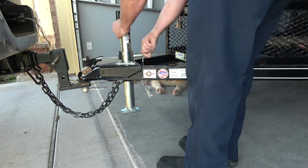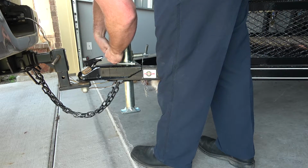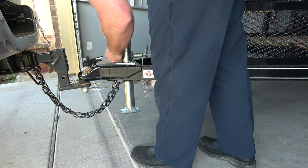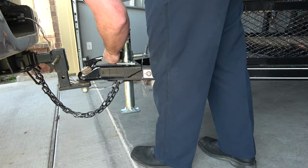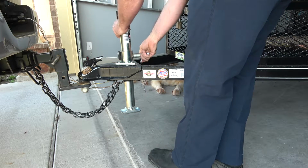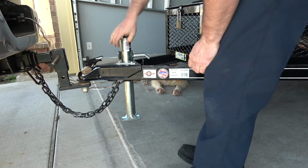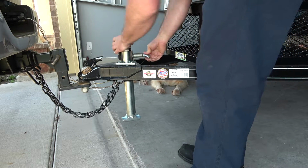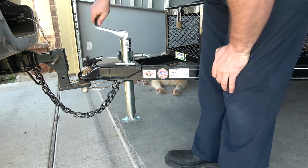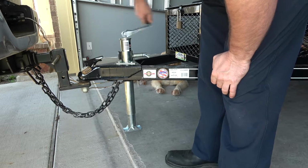So we'll go ahead and demonstrate now. This is what I love about this jack here. I've got to adjust. There's that little black piece of plastic on the front, and it basically fits into a hole in the side of that tubular brace and creates friction against the main shaft of the jack. And you can adjust that as to how easy the jack is to retract and lower. I was just getting that set up there. Getting a little lock pin out of the way here. That little stem that you see coming out of the side of the jack facing the rear of the trailer has a little bevel on it. So as you turn that handle, it slides that locking shaft in and out from little notches on there.